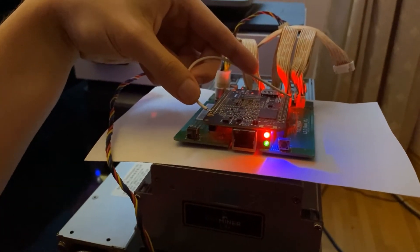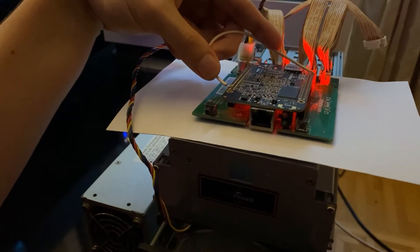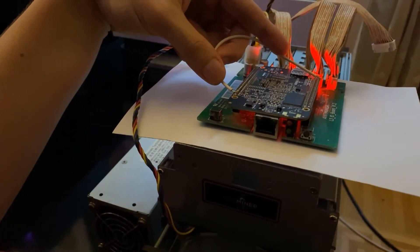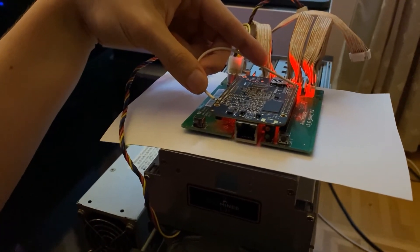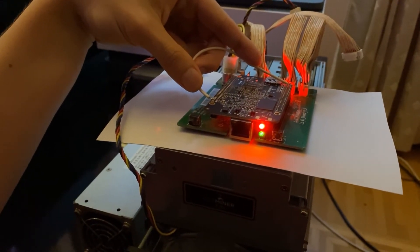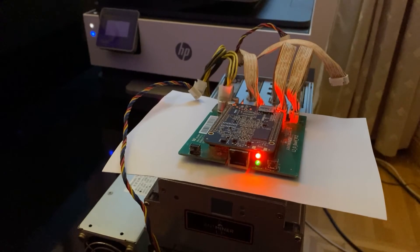You're going to get the blue light, and normally the green and red lights will turn off. What we're looking for is for both the red and green lights to start flashing simultaneously — once both of them start flashing at the same time, you know that you've succeeded. And that's it — you can let go now. You've successfully flashed your miner and removed the virus.